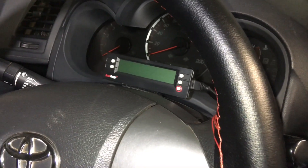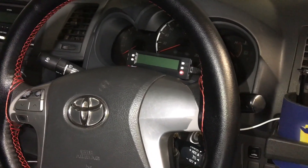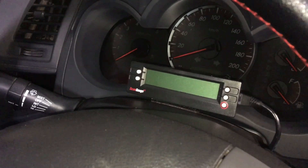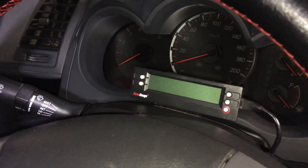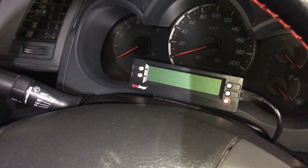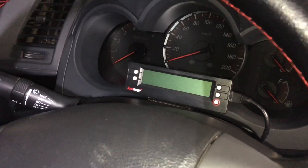There are different PIDs you put in, so Tom has to press the button to get different auto temperature readings. This four-speed auto Hilux — we call it slipping to keep it simple — makes a lot of heat in the transmission. It's pretty good and stays under control compared to the 2019 1GD, which was the worst of all, absolutely by far. Loved the vehicle, didn't like the lack of engine power, and the worst part was the transmission software. This Hilux slips very similarly but the temperature stays down a bit better and comes down a lot quicker once it locks.